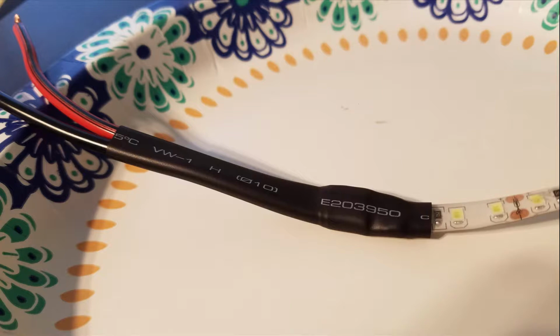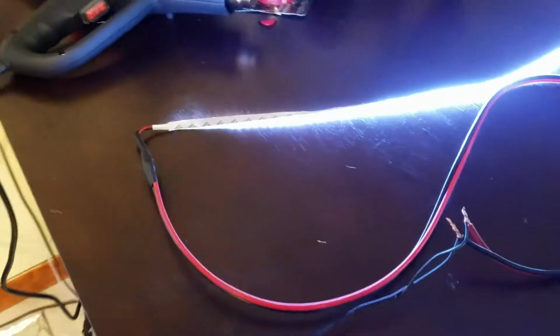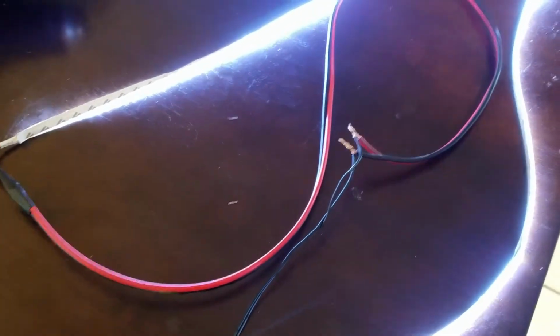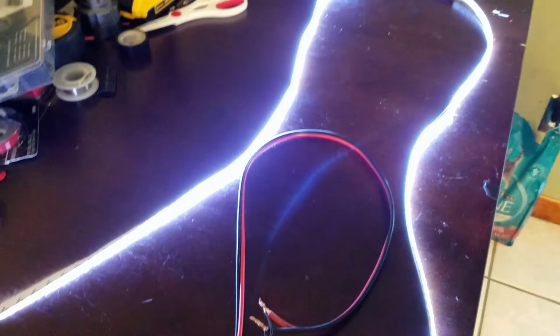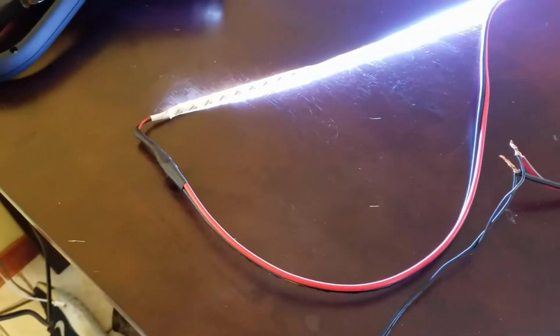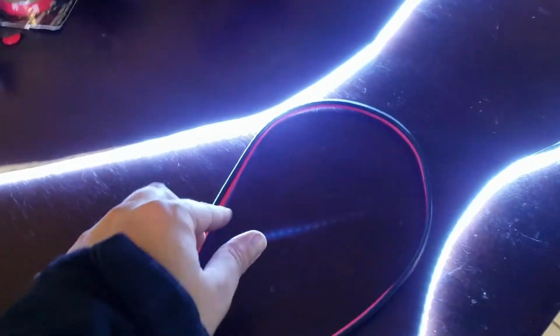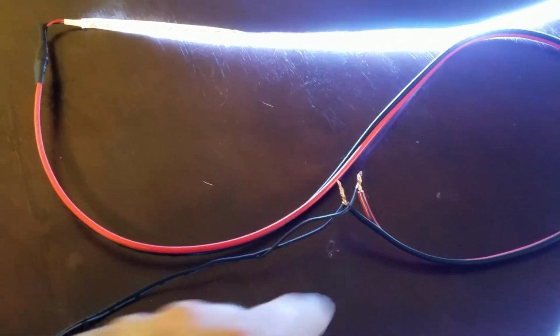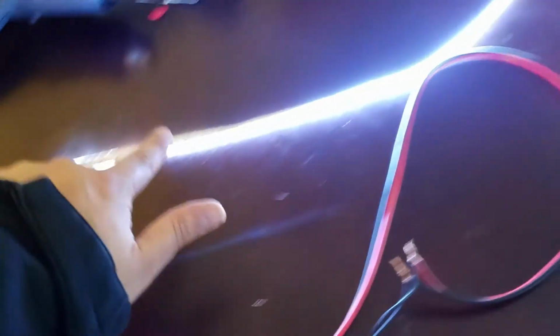Now in the next video I'm going to show you the final product. Alright guys, so in this video I'm showing you that the two 34-inch LED strips are working, and again I have the two strips attached by a 6-inch gap of red and black wire. Then I have this 16-inch long red and black wire, and that's what we're going to use to attach to the existing trunk light in the Hyundai Sonata.